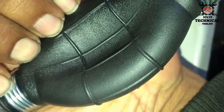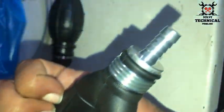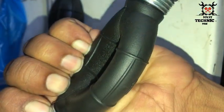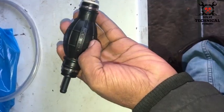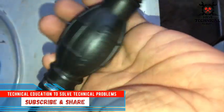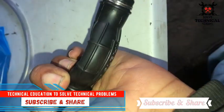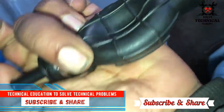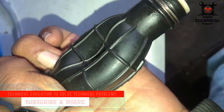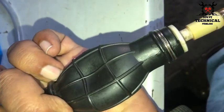That is the Delphi primer pump, and this is the replacement part — a Chinese-made Delphi primer pump. Here you can see the new one is holding pressure. On the original Delphi primer pump, you can feel the leakage — it's releasing pressure back, and the non-return valve inside this Delphi pump is not working.